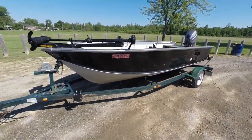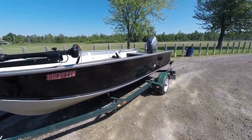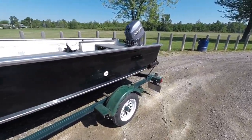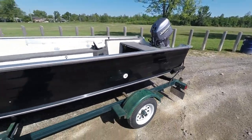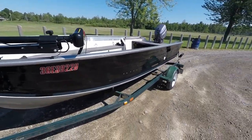I've had a few people asking me to do a video on the vinyl wrap on this boat because I didn't do one as I was installing it. It's actually a little bit harder than I originally had thought it would be. It's definitely a two or three person job. A couple things I didn't do which I'd really recommend you do is get their edge sealer and their primer. I'll show you why.